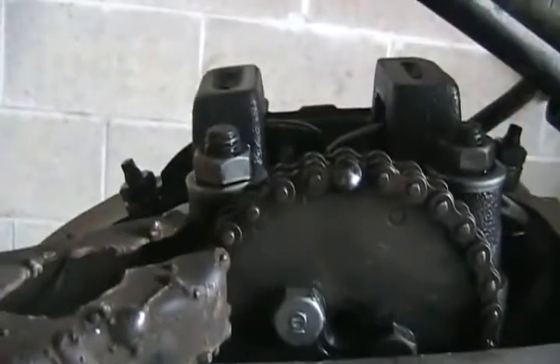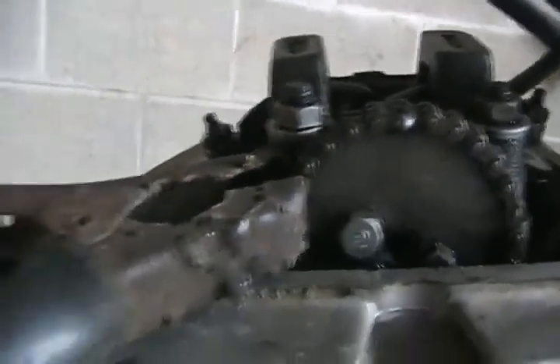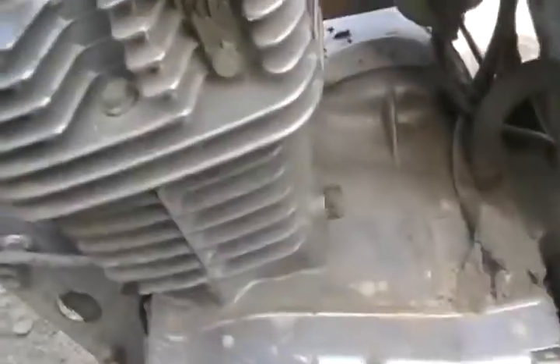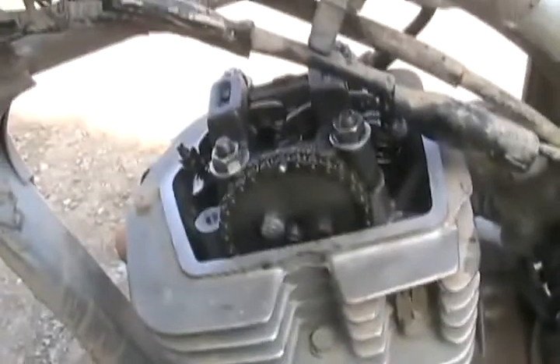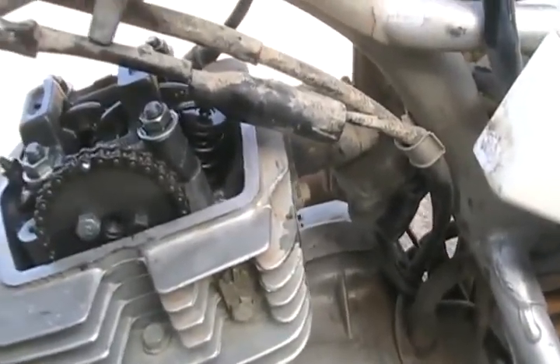Done - just took a wink of an eye. There's the little blob. It's just fine, it doesn't get in the way or anything. I put the ground right there - it grounds the sprocket and chain. That's tightened, that's lined up, that's tightened. We're all set to put the cover back on. Drain the bowl on the carb because it hasn't been started in eight months, and see if it fires up in one kick.